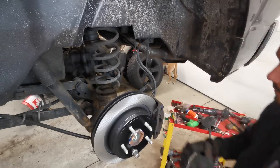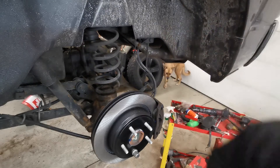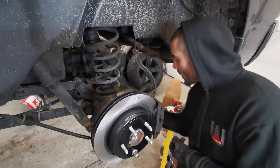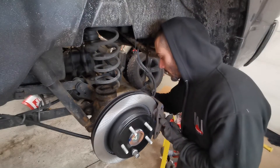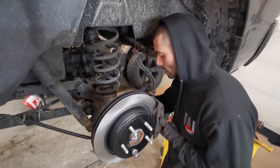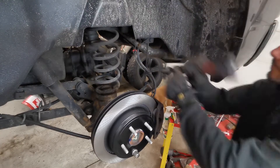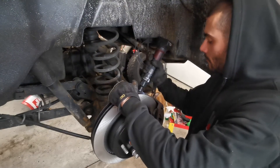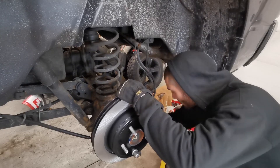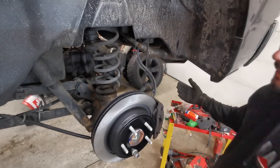Now this is for the left rear — the right rear is opposite. It's got to go up on the top and rest on the bottom. But that's how you slip that in. Now let's go ahead and put our bolts back in — got some Loctite on our bolts here. Make sure everything is started by hand; you don't want to create any surprises for yourself. Get your ratchet, and again, finish by hand so you get a good feel for it. Everything's good, everything moves — nice new braking system.